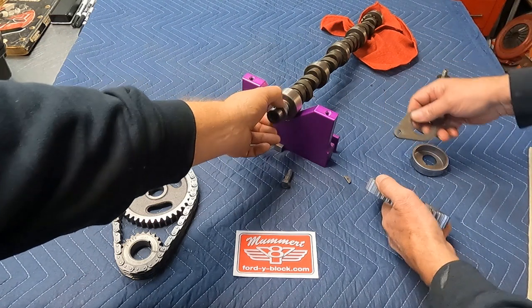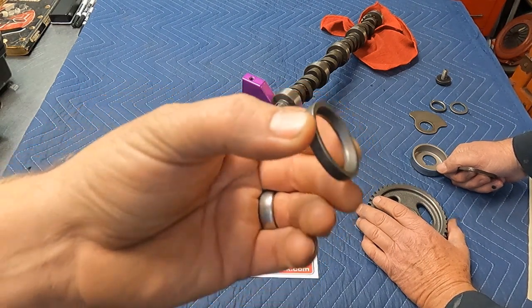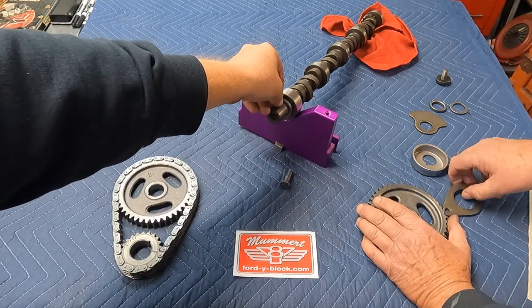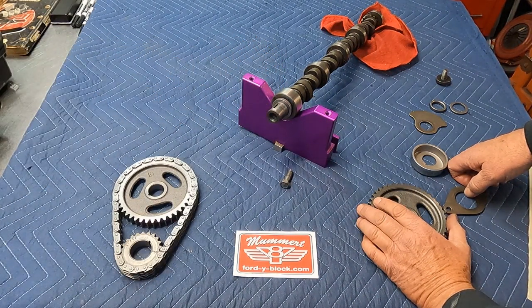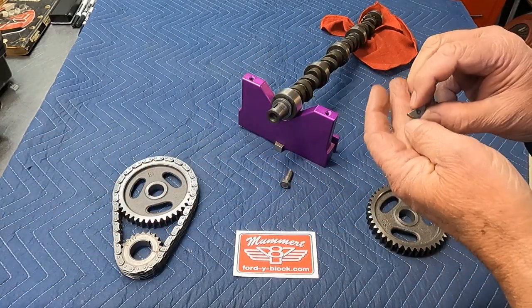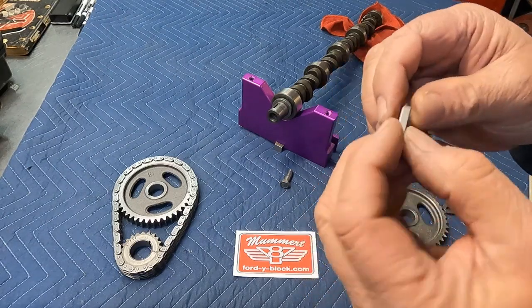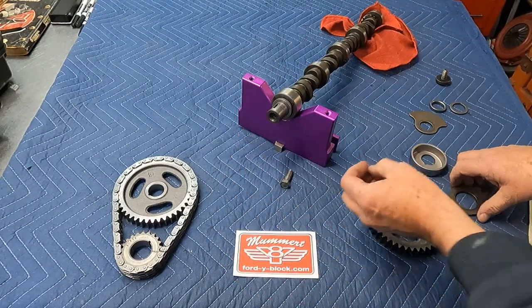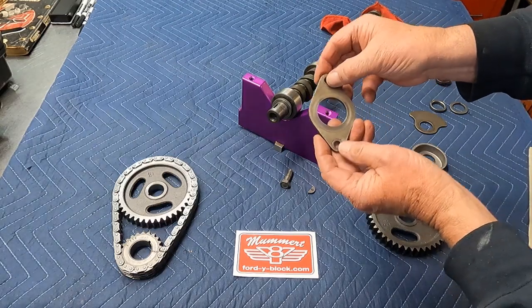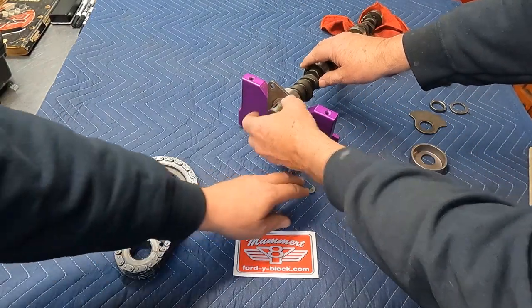So hold on, did you guys get that? Before you install the cam, you're going to take the big bevel washer and install it on the cam, and install your keyway. Then you're going to install your cam in the engine and start stacking the parts on. This particular Woodruff key is a number 8. If you need to find one, this is a number 8 Woodruff key. Then you can put your thrust plate on, and other than some chew marks from having been installed with lock washers, they're basically non-directional.